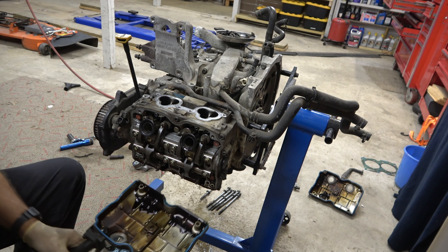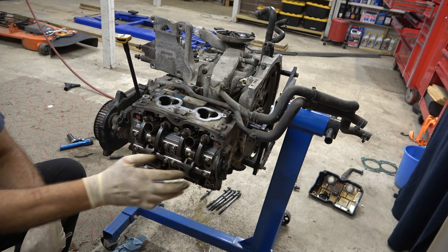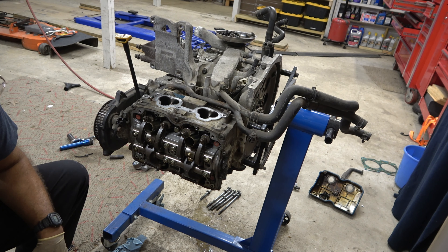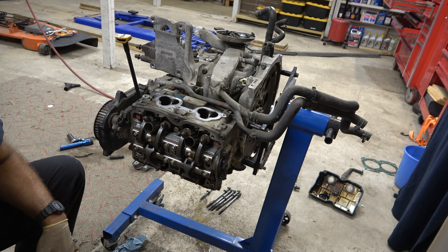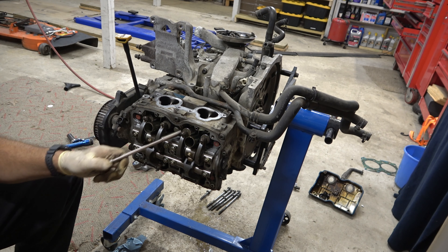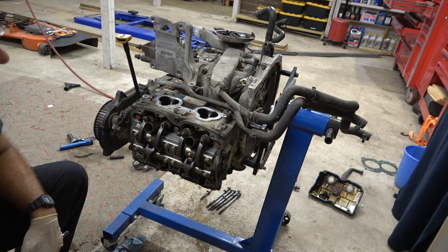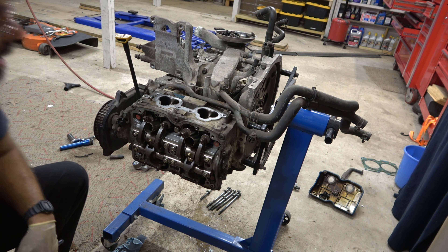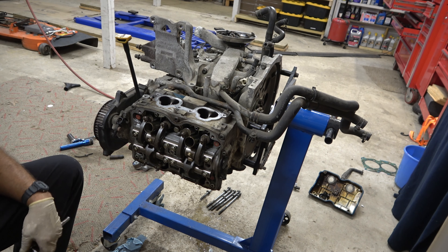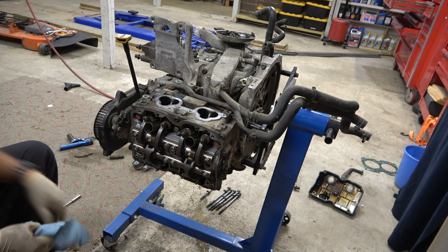There are the guts — a little bit of oil still left in this one. We take off these spark plug tubes here. What you see here are our valves — intake and exhaust valves — and it still looks pretty good. I'm going to get a drip pan to catch some of this stuff. You can see these red-colored ones here — there are six head bolts, and we're going to take those off in a star pattern. Then the head comes off. There's just not a lot to it on these single-cam engines; it's really nice.